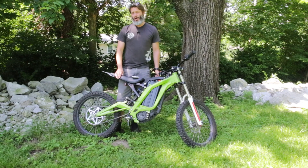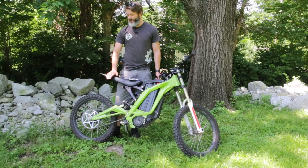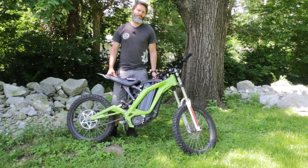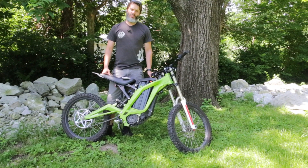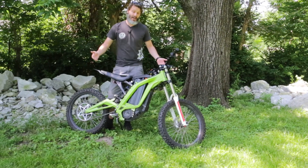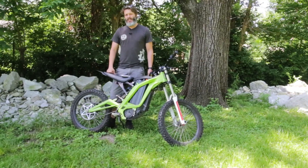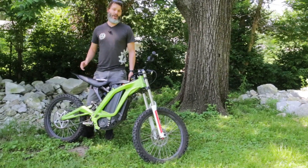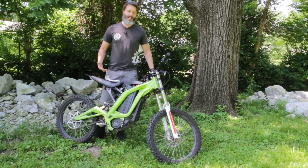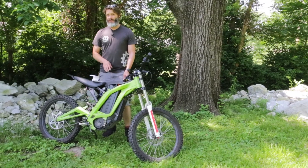There is a downside to gearing down on an electric vehicle — you may actually lose some power and that mid-range snap. I definitely feel that this bike gained that 20% torque off the line, but once it gets past 10 or 15 miles an hour it starts falling flat. Essentially we're just not loading down the motor enough. The motor is like, if you're not going to ask for 5,000 watts I'm not going to give you 5,000 watts — that's how electric motors work. When I'm at mid-throttle it's already past the point of phase amp limiting and battery amp limiting, and it's just putting out whatever the motor is being asked for, which is less than when a motor is geared taller. So it feels weaker in the mid-range for sure.